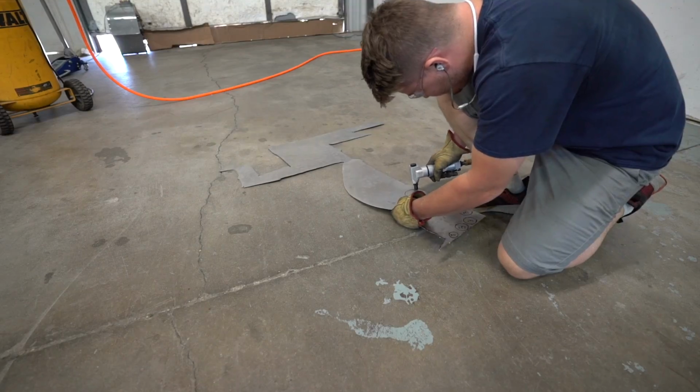Yeah, and if you're wondering why you're supposed to plug these holes, it's just good to have them plugged. That way, if anything catches on fire in the engine bay, nothing wants to come into the car, or it's harder for it to come into the car if you have all the holes plugged. So that's what we're gonna be doing. Gonna cut these plates out and then tack them all in, and then I need to order some more seam sealer to seam seal the backside of them, but that's not a big deal to do later on.